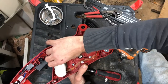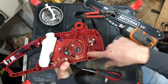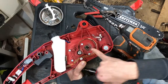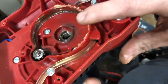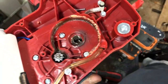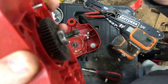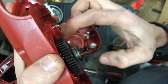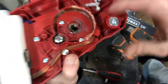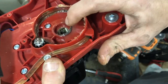Getting on into the housing here — we've got our oiling bottle. Looks like they run the hose down below and then back out, which is pretty nice. There's also a gear down in there for the pump itself, it rides on the spindle. On the end of this spindle right here it's an actual screw, so as this spins it screws down or up — and turns that little gear down in there and you get oil. That is a metal gear as well.